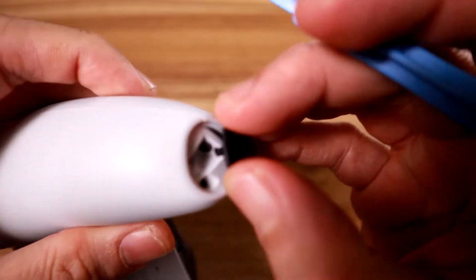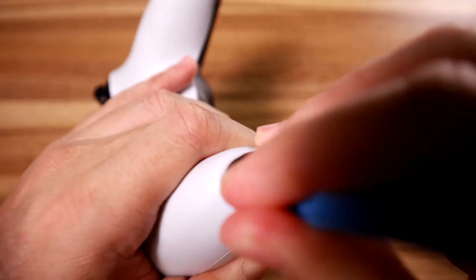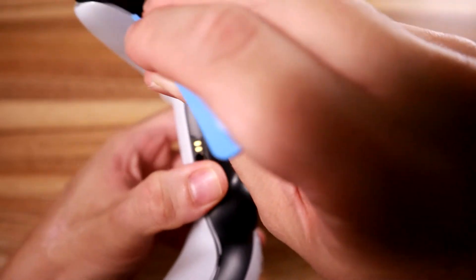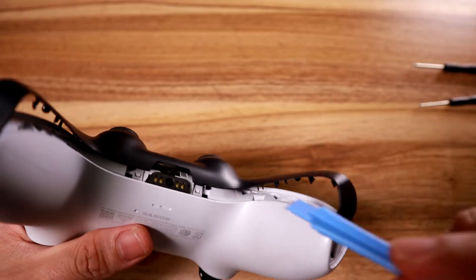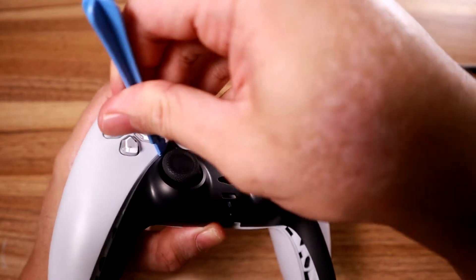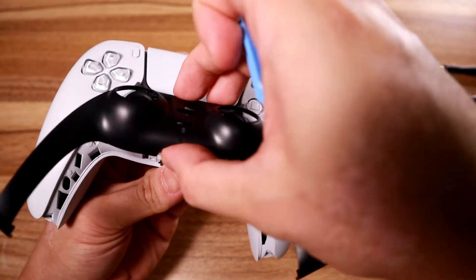So that's your first step - you find a little opening and pry it open. It's just a clip; it clips into the controller like so. Then you do it for the other end - be very, very gentle because you don't want to break that clip. Take the same separator and go under here and try to get it off, be very gentle, because there are a lot of small teeth that go into the plastic. You have to make sure they're all off. Instead of pulling it outward, you pull it up and out, because there are 'bat ears' that go into that space.